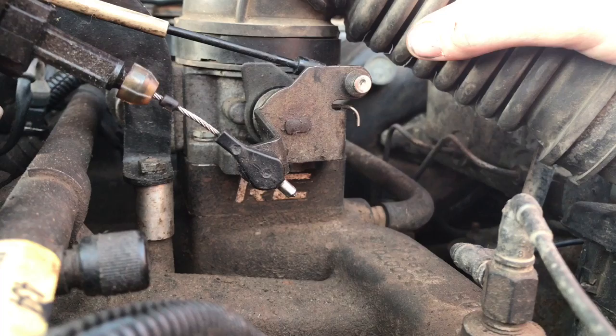I'm going to go ahead and take it for a test drive and make sure things are shifting right. There are a couple videos on YouTube about this, but I wanted to show my own way — this is how the shops do it. A lot of people get it confused just from calling it a kickdown cable. This is a '91 and mine had a lot of slack in it and it was shifting funny. I've seen people actually get transmissions rebuilt and put in, only to realize it was just something as simple as that. So make sure you check something like that before you say there's something wrong with your transmission.